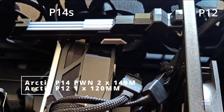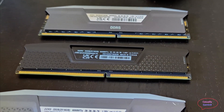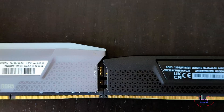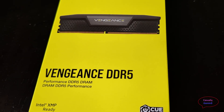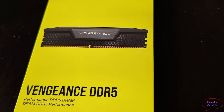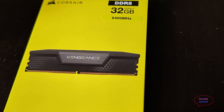The testing results are with the lower-profile kit. The front intake setup is two P14s and one P12 — this provides enough air for the CPU to cool. I must confess I was expecting lower temperatures with the lower-profile kits but that was not the case. With both CPU coolers I will be using these kits to do some memory scaling testing on the 7800X3D.